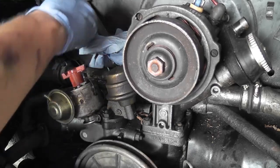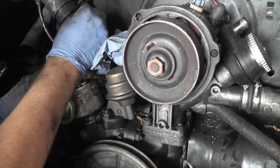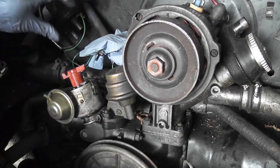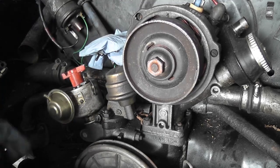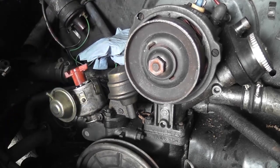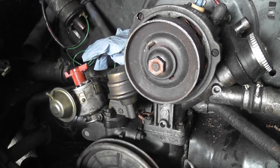The timing should be within the ballpark. Now we can connect up our points to the distributor. The points connect to the negative side — what they do is essentially lift the negative from the coil, which sends a high voltage pulse from the primary windings to the secondary windings and then down to the spark plug. That's what your points are actually doing. The distributor is in; pop our nut back on and tighten it. Now we can change our spark plugs.